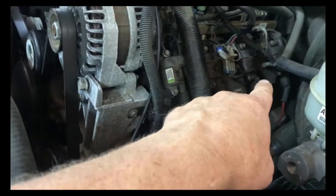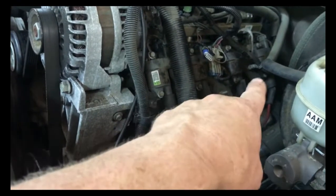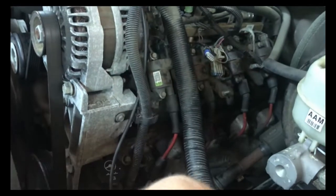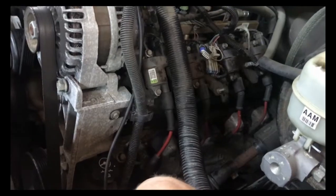That's kind of weird. So I pulled one of the coils back from there and switched it to see if I had spark. When I did that, I still had no spark. Then I realized this whole bank didn't have spark. So sometimes you cannot really rely on the computer to give you the proper misfire counts.